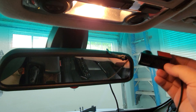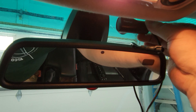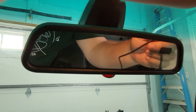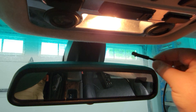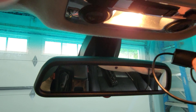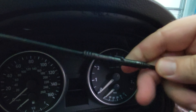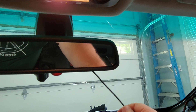Here is the dash cam and we're going to end up mounting it right here. I don't want to mount it yet because we need to make sure the camera isn't obstructed by this piece of the mirror housing. So I want to run the cable first and make sure everything's good to go. We're going to connect the two pieces of this wire — part of the USB cable is right here and we're going to connect that to the other end of the cable for the camera. These two pieces just go together and they're keyed, so you can't put them in the wrong way. You're going to hear it click. Now that the camera cable is connected, I'm just going to attach the camera here and hang it.